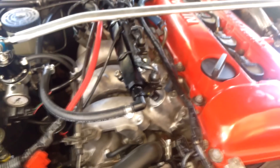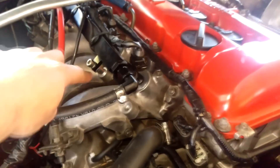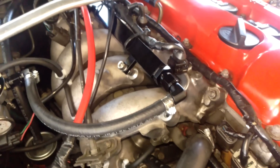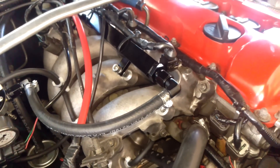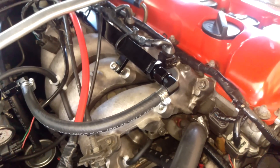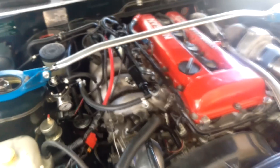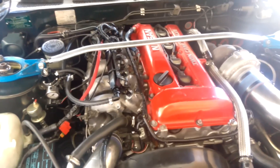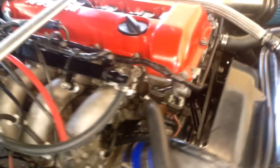These are three-quarter length injectors, not full length. This particular Airflow fuel rail kit is made for full-length injectors, so the spacers between the rail and inlet manifold were too long. It was a matter of trial and error — I had to cut them down and file them, but being aluminium they're easy to file. The required length will vary depending on your injector, but if you have these specific injectors and rail, comment below and I'll give you the measurement.